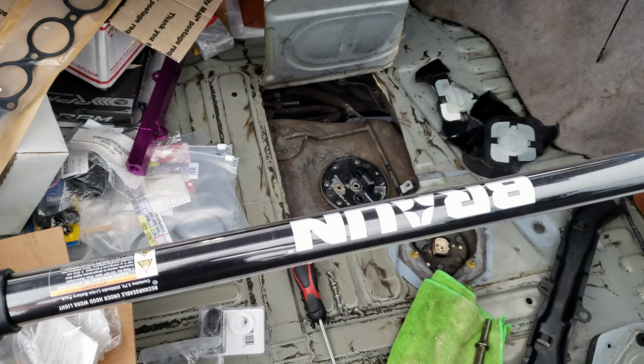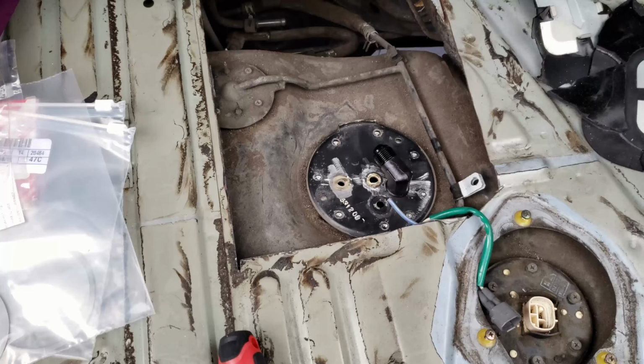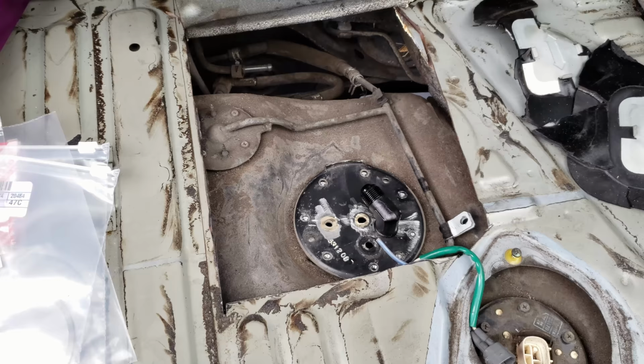All right, recap. I was over here working with my buddy John the other day. Didn't get much done. We're working on his cars. So I got the bulkhead on the fuel hanger. So 90 degree bulkhead dash 8 for the feed. I'm going to run the new hose now, snake it down, run all the way to the front. But first I got to take off all the stock lines, the stock feed and stock return.